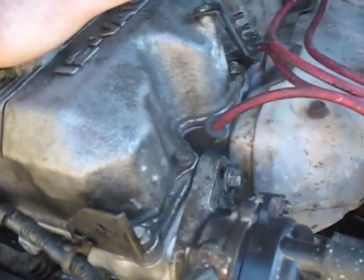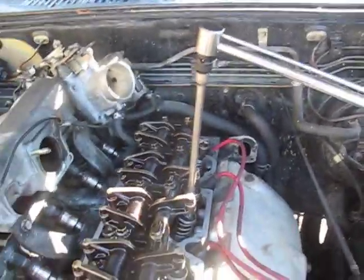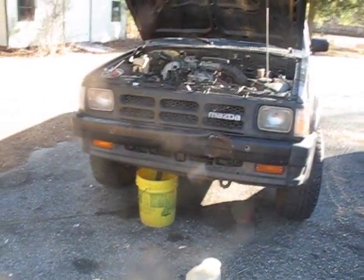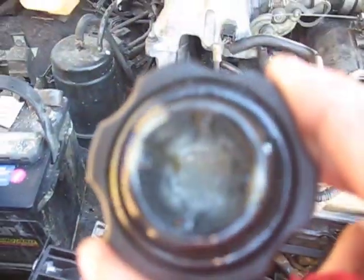What I'm going to do is take the valve cover back off and re-torque those head bolts, put it back on, and then I'm going to do a coolant flush and change the oil. Torquing down the head bolts. Flushing out the cooling system one more time — no longer pressurizing the cooling system, which is a very good sign. Now I'm changing my oil, which was all kinds of contaminated with water. Look at that. Yuck.